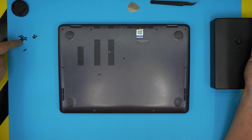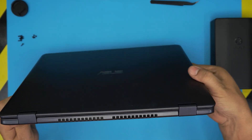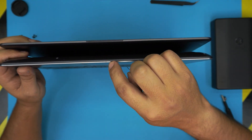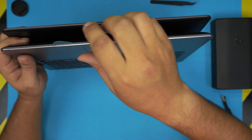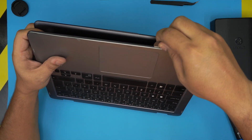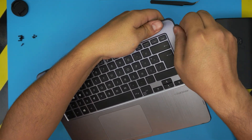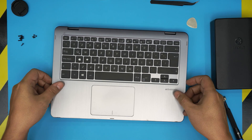So I have the short ones, the long ones, and the medium one. Now we're going to open the laptop 360 degrees — flip it completely over. Stick the guitar pick or opening tool right between the top and bottom cover, about one or two millimeters in, and twist it inward toward the keyboard to release the clips. You want to hear that clicking sound. Go all the way to the back corners, left and right side.